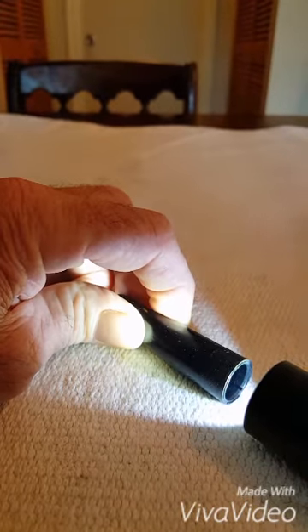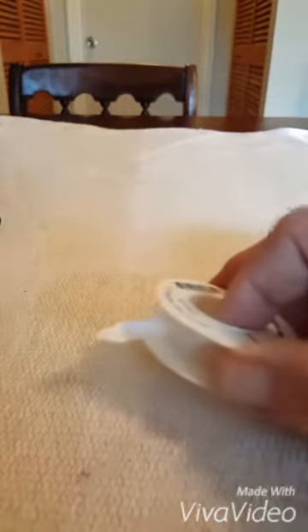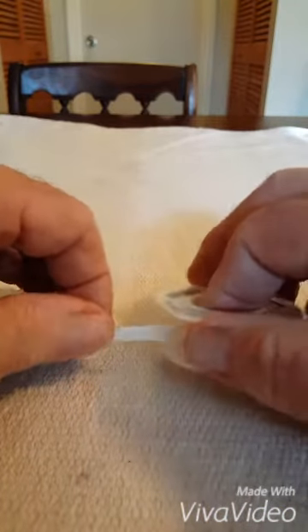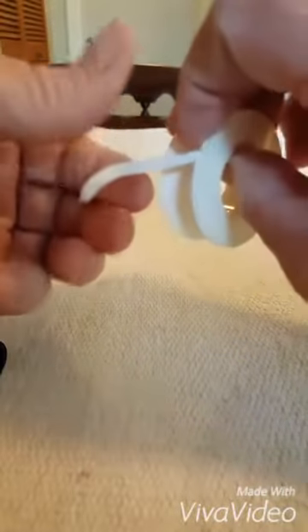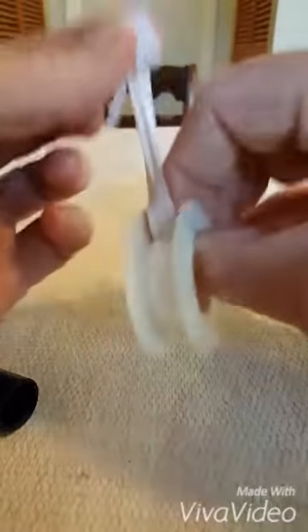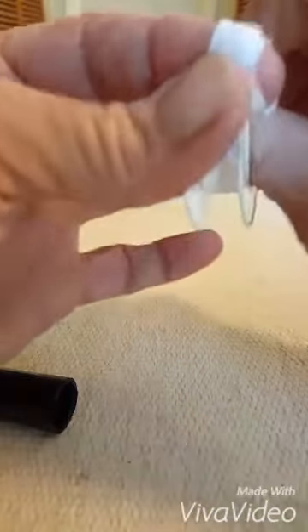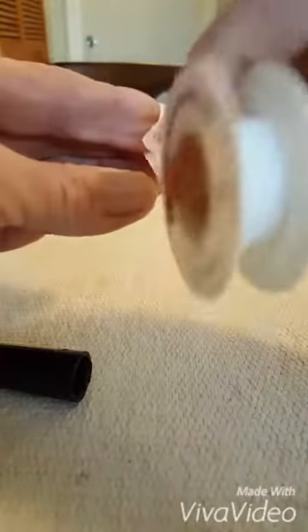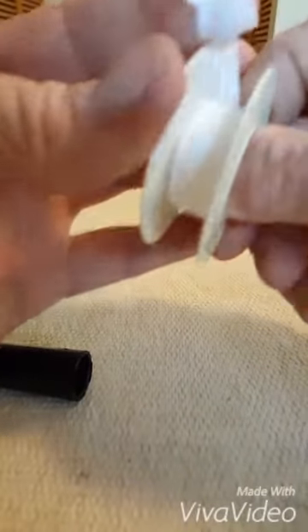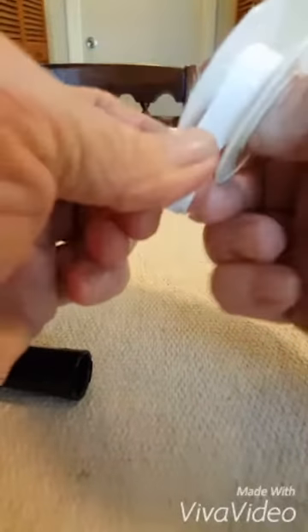All right, how are we going to do it? Well, I figured I'd just use Teflon tape. It's good for high heat service and I'll just get a few wraps on my finger and lap it over that notch. I think that's going to take care of it for us. Just need to get enough tape to lap over there and fill that notch. Four or five wraps like that should do it.